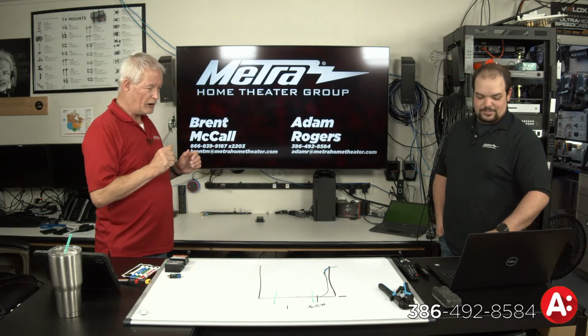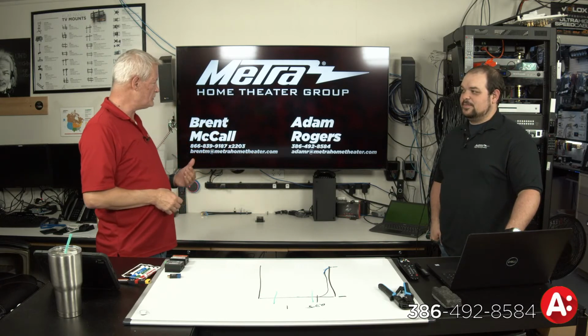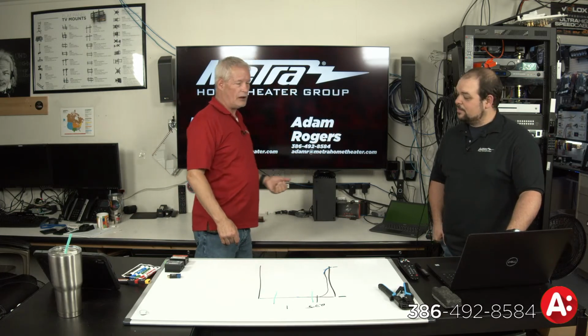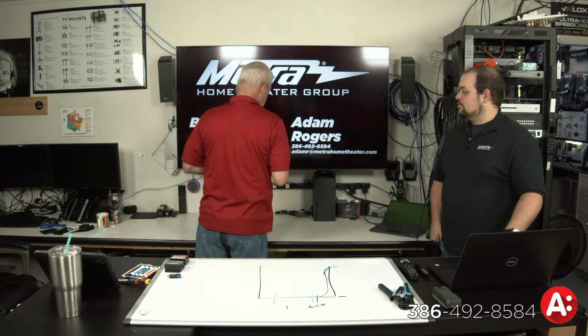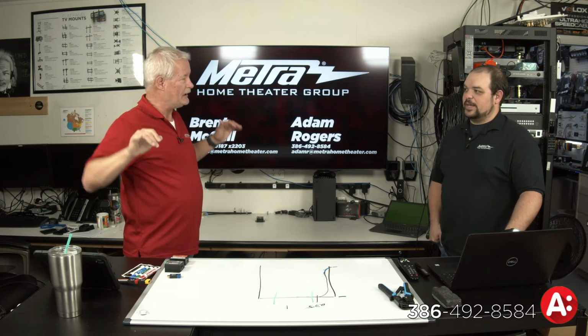Right. Televisions now keep hot plug hot. And they do this because they assume that you're plugging everything directly into the television. You're not going through an extender, you're not going through an AVR, you're not going through a splitter, you're not going through a matrix. You got your cable box, you got your TV. And they keep these hot so that when you change inputs, it queues up faster.